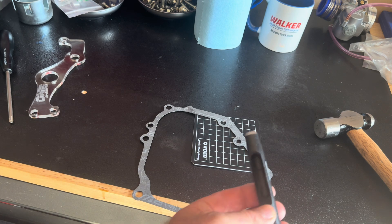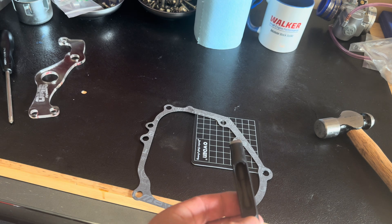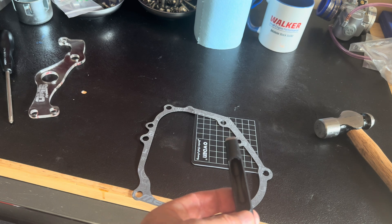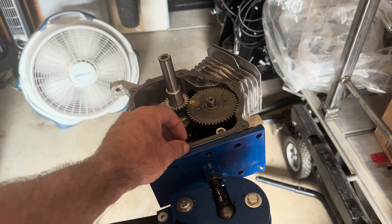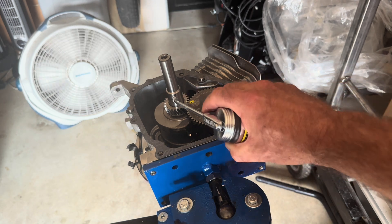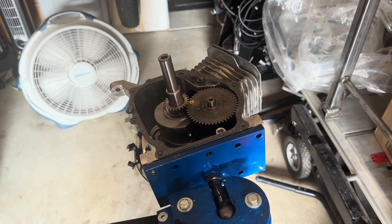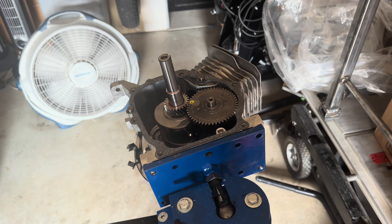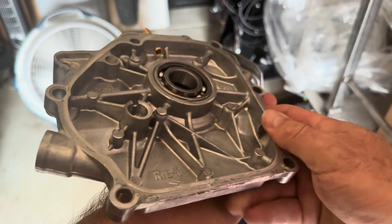To make the hole bigger, we're going to use a 3/8 inch hole punch. I did this off camera — just had to make sure I got it in the right place. I punched the holes out, made sure the gasket surface was clean again, and got the gasket on there. I'll put a little oil on the crankshaft and grease the seal — you don't want a dry seal — and just a little oil on there will help everything go together easier. Now we take our inspected side cover for final inspection and set it in place.